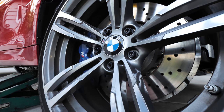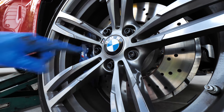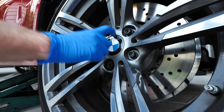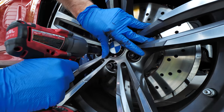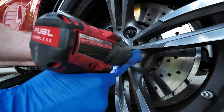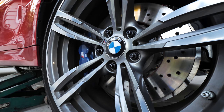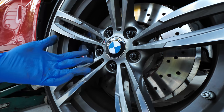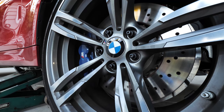This is typical on regular wheel bolts as well — you want to torque them down between every session. Also make sure to remove your center cap if you're on track or else you're going to melt it. That looks awesome. I like the way these lug nuts hang out — that's why I went with these and not tuner lug nuts. I'm not a huge fan of tuner lug nuts; these are very simple and lighter weight, and lightweight is always good.